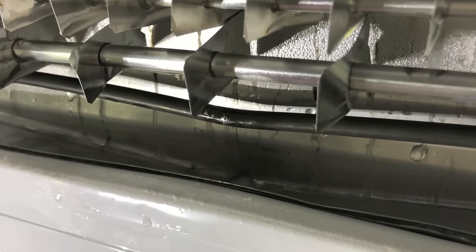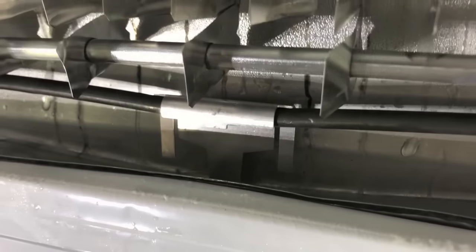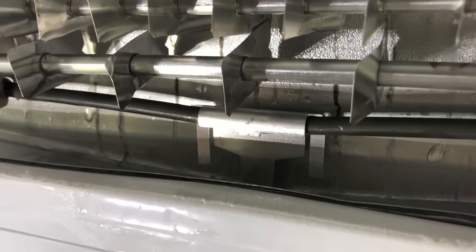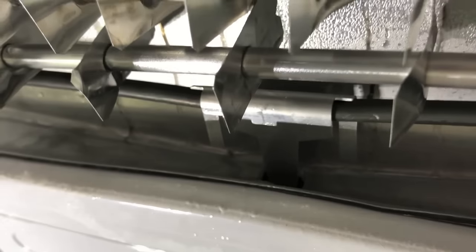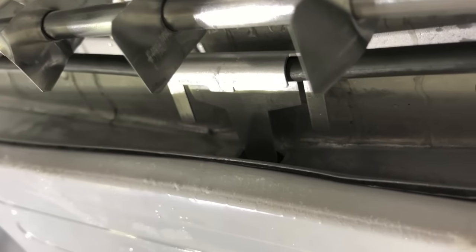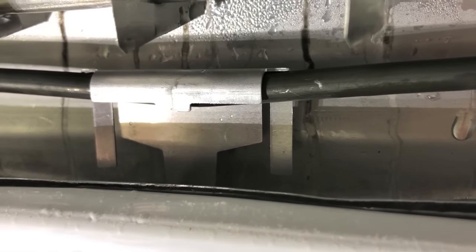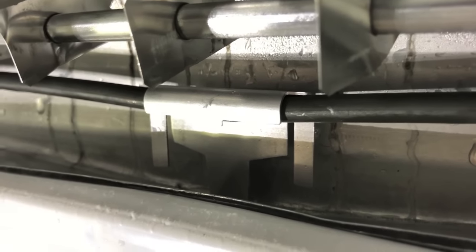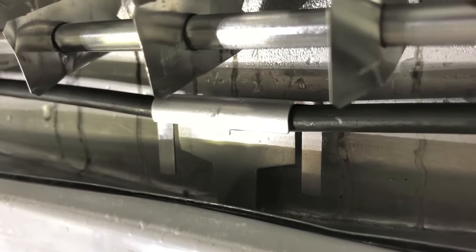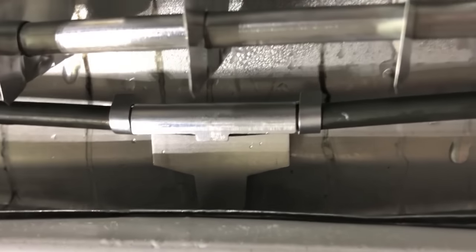Next I'm going to add the newer designed evaporator drain clip. I now have the replacement clip in, and as you can see it's a lot wider than the original factory one. That fin extends down into the drain hole, and the tabs on the side wrap around the heating element. There you have it — the tabs are wrapped around the heating element and we are good to go on putting everything back together.